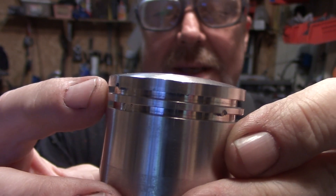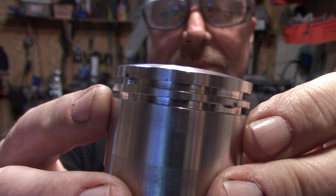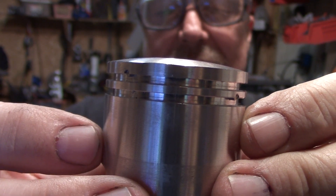How do I know it's the intake side of the piston? Take a look — you see this locating pin right there, and that one right there. That's how you tell the orientation of the piston.